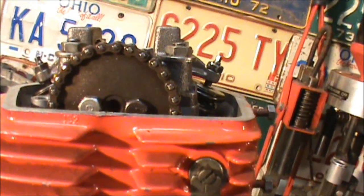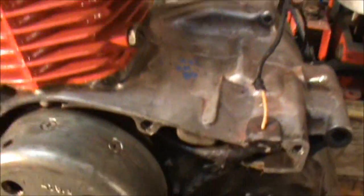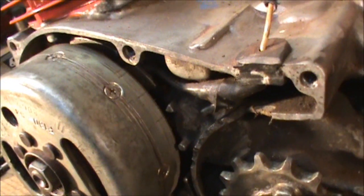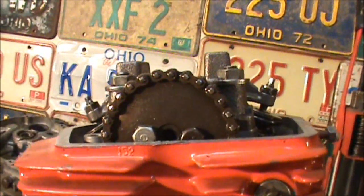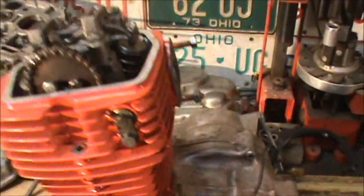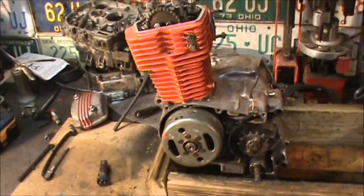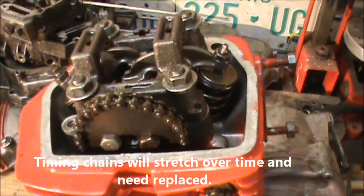So when you're setting your chain, look at this little circle mark right there and the T mark here. I've pulled my spark plug out so it's a lot easier to rotate the crank over. So the T's lined up and the circle's lined up — you can tell it's not completely even looking. This engine may need the timing chain adjusted; there might be a lot of slack in it. So if you're having a lot of trouble trying to get it perfect, it might be about time to get that timing chain replaced.